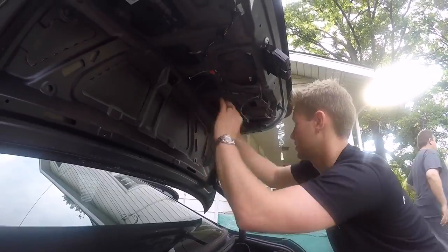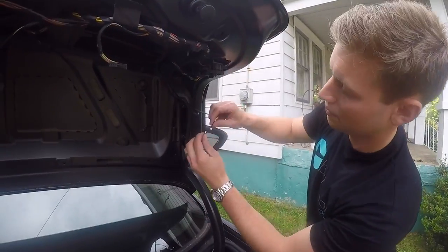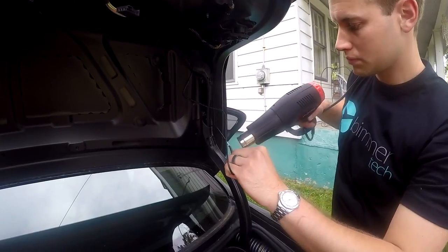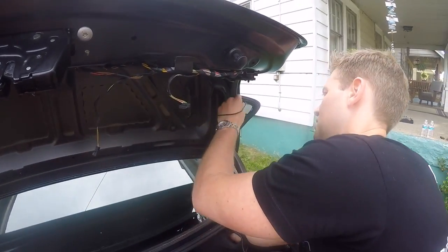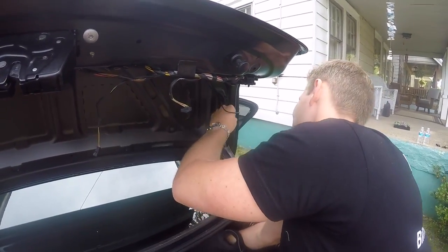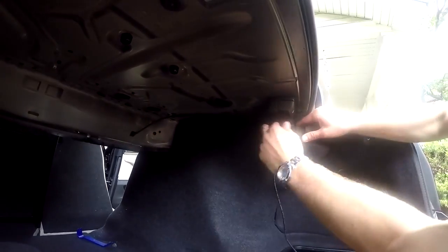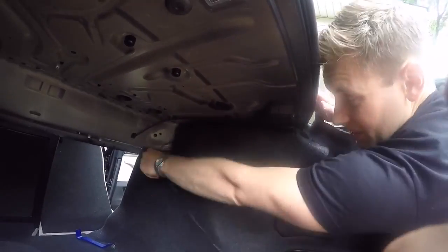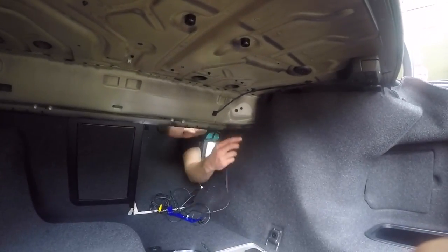Route the rear view camera's wire to this connection and connect the two of them. Then secure them with either heat shrink or electrical tape. Continue guiding the wire through the trunk arm, removing any additional slack. Secure the rear view camera extension cable behind the carpeting with zip ties, then feed the remaining wire through the rear seat.